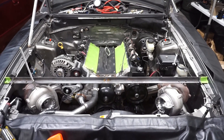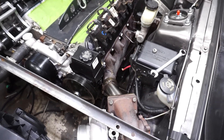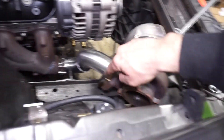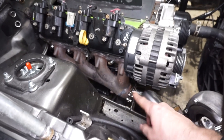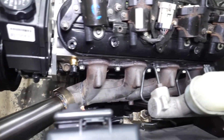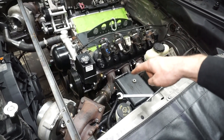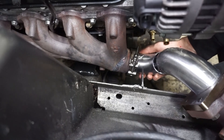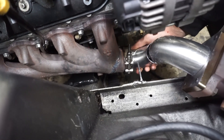It's tricky trying to get asymmetrical turbos to look as symmetrical as possible. This one is a nice straight shot into the turbo and I don't really see a reason to add a bend just for the sake of it. This one has the bend because we're limited by how far we can rotate the turbo, and this manifold is actually physically one inch lower than the manifold on the other side. On the trucks, the driver and passenger manifolds are slightly different — you can see this one is bigger and more beefy. So I did trim a little piece off of this 90, brought it back a little bit, and it should line up pretty well with this piece. I'll measure that gap and tack a couple pieces on to see how close we can get.